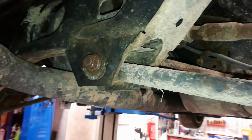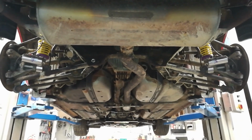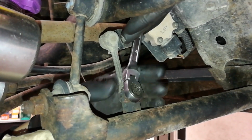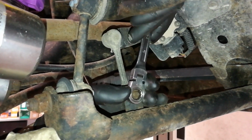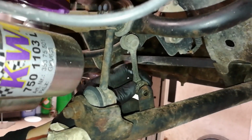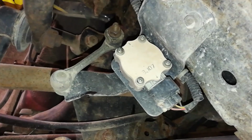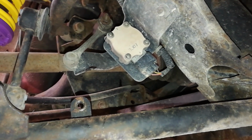This is my old control arm, and we can see that it has seen better days, but a problematic part is this nut, as it was impossible to adjust the alignment because one was stuck and the other snapped. Next up, we have to remove the headlight leveling sensor on the driver's side arm. Remove the nut, take out the leveling arm, and reattach the nut back on the arm so you won't lose it. When done, put it out of the way, like this.